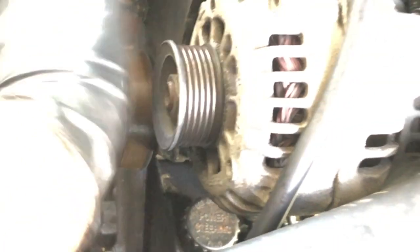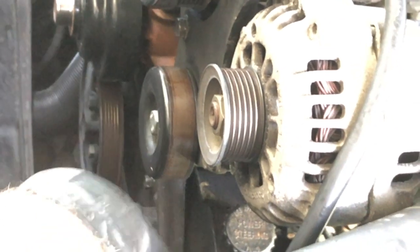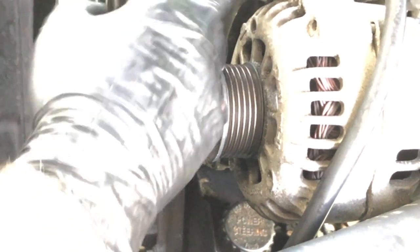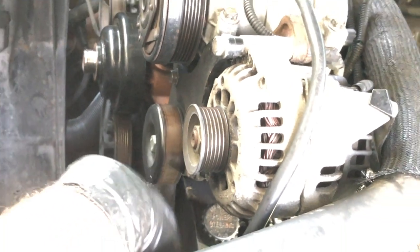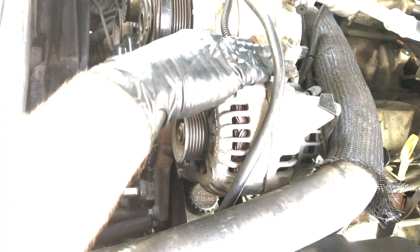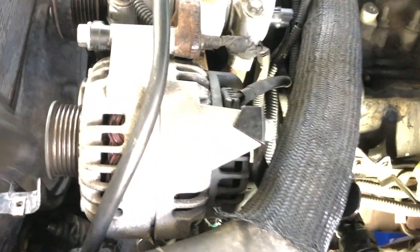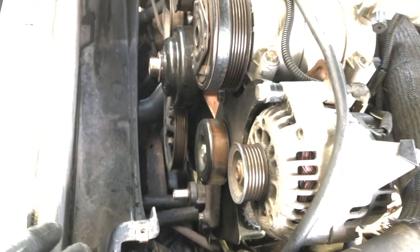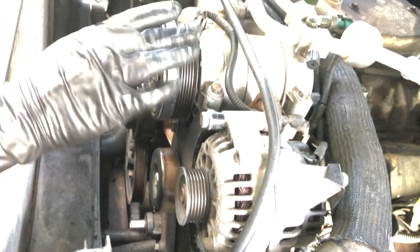I don't know if you guys have the same setup I do, but this idler pulley bracket has 2 18 foot-pound torque bolts on it, and then, of course, these go 18 foot-pounds for the right-hand side, and the left-hand side is tighter. It's 37 foot-pounds. And, of course, don't forget to put the connector back in and put the battery line back on the back. All right, our next step will be to put the pulley on the pump, so then we can put the serpentine belt back on, then the fan shroud, and get to where we can start the next thing. We're not done on this.